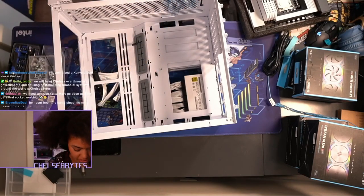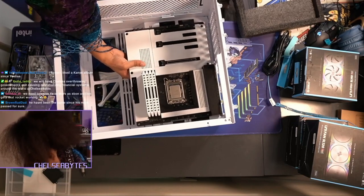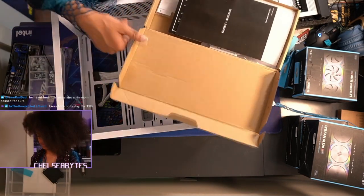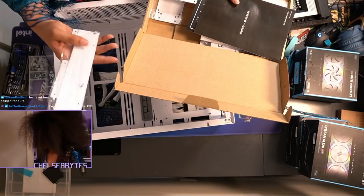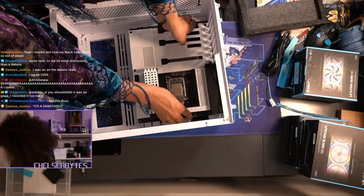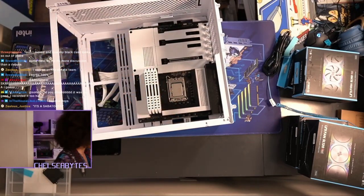So for this particular case, depending on how big the motherboard is, we need to go ahead and install the extension. There's an extension plate that you need to install — it comes with its own screws and everything. Here it is. I'm gonna start screwing in the motherboard. We got the bracket in for the CPU cooler. There we go. Now I can see all the contacts.